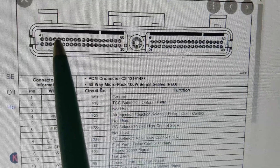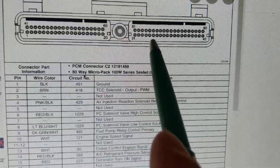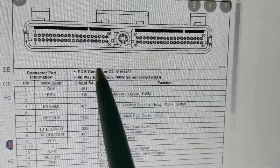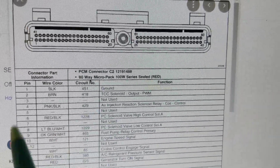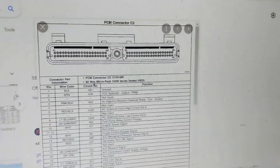So: 1 to 20, continue to 21 to 40, then 41 to 60, then 61 to 80. Basically you continue across connectors. This is very tricky — if you don't realize this and don't refer to the diagram, you'll think pin 20 is followed by pin 21 on the same connector and you'll make big mistakes. That's why it's so important to go to the diagram.